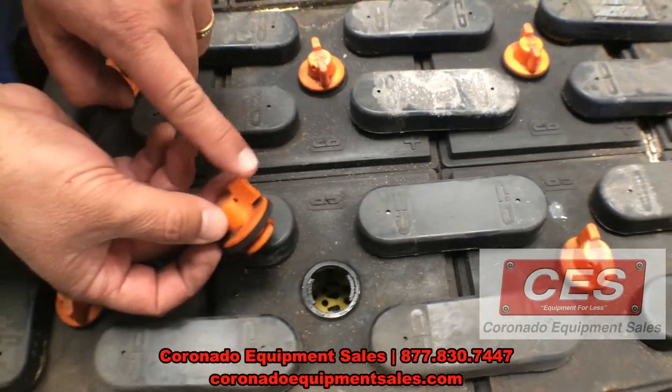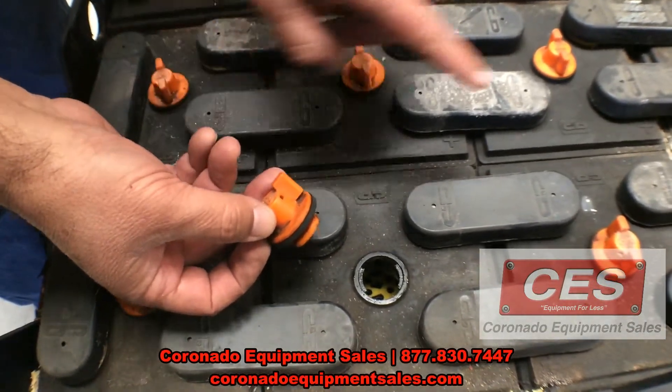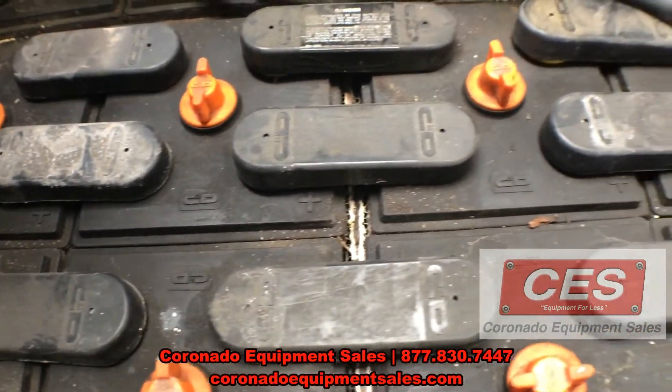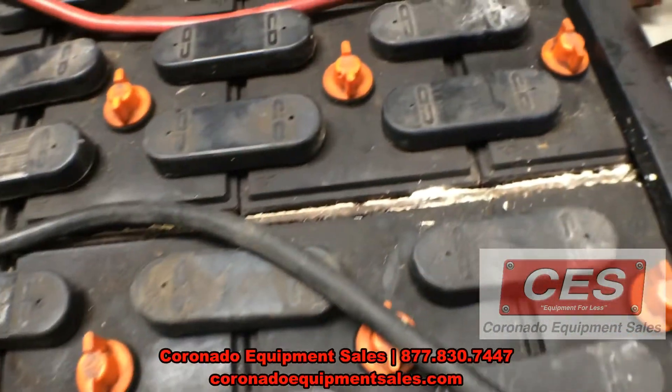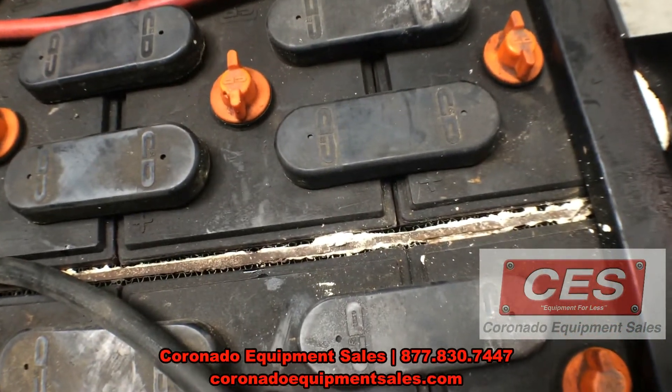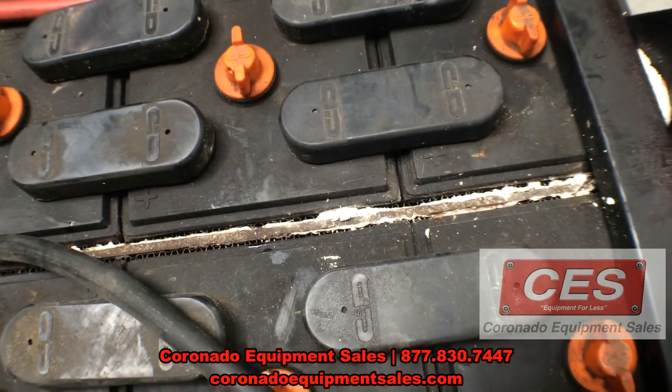What happens is the hot air releases out. If you have it completely full, you get spray coming out and that's where you get all the acid on the outside of the plates, on the outside of the battery. It doesn't mean it's a bad battery — it just means the battery has been over-watered at times and some of it has been coming out during charge.